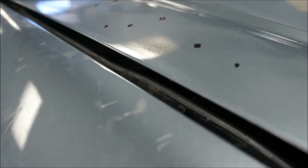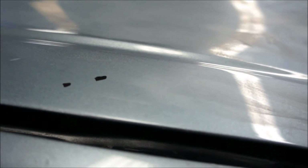But usually when you run over, you see how dull that is. When you run over 2,500, that'll really show any shiny spots or dirt spots or whatever. So you may not want to do that, but still, sometimes I'll miss them, and I'll get the polish and then find one. And I'm like, dadgummit, now I got to go back over, get sandpaper, do the whole thing. So that might save you a little bit, because you can see them clear as day sticking out everywhere. So you know if it's still black, you didn't get it.